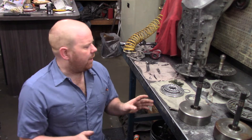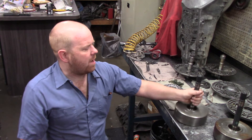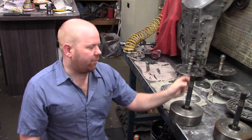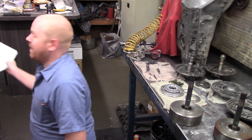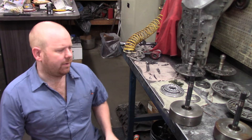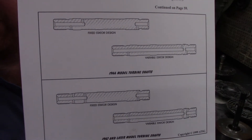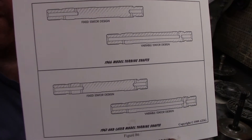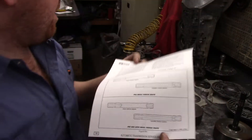With the pumps and the variances — whether you can interchange — I'm not entirely sure. I'm going to run this input shaft as-is with the single feeds. With the dual feeds, like most of them, I don't know if there's an issue; I can always drill it. There are your differences on the input shafts — you can see the passage variances. Notice the '66, which is like a '65, has singles. The '67 and up has dual feeds.